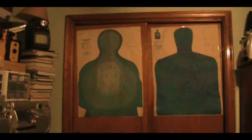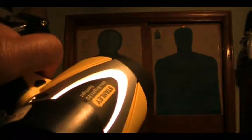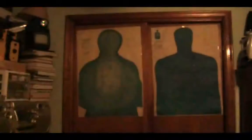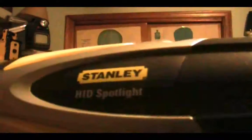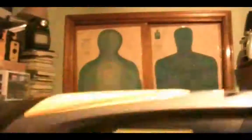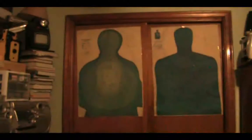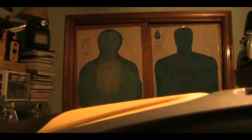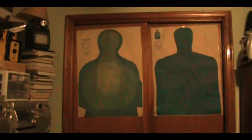I'll be comparing this to the Stanley 5-watt LED spotlight. That unit puts out 192 lumens at its brightest setting — not quite 200. And this HID doesn't put out 1000 lumens — it actually puts out 3000 lumens, as you'll see. It has a pretty quick startup because they over-boost the bulb slightly to get it going in just a few seconds. Let's turn out the lights and start it up.